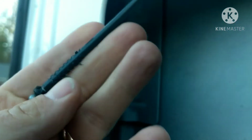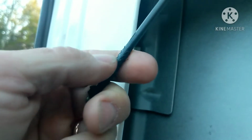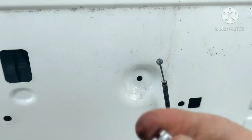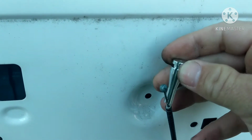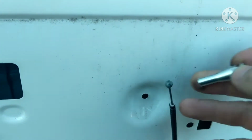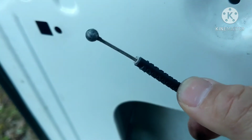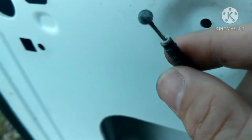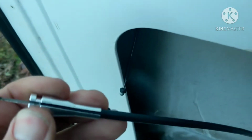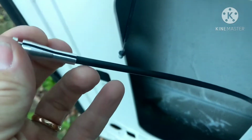All junky here. We've got to get all this old end off of it, all these dead pieces. Get a pair of pliers and cut them all off and clean up the cable, so you have a nice clean cable. These have a slit on one side, and you just slide it over the cable, so the cable is in the center of it, and you slide it down. But you have to clean up; you can't just slide it on. You have to clean up all those ridges from the previous plastic end. So I'm going to get a razor blade and shave it down. When you shave off enough, you can see the cable housing slid all the way up. You want to make sure the housing is slid all the way up into this end piece. And now we have our good end.